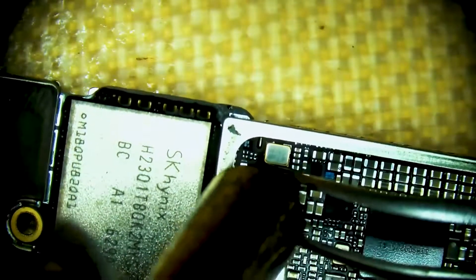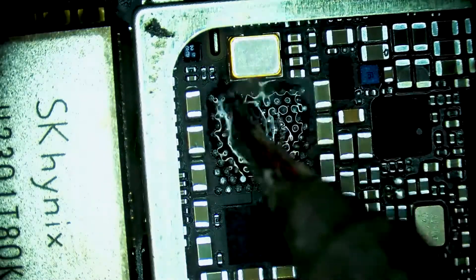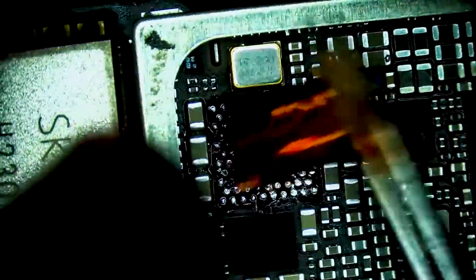We're going to use the gravity method to let the board fall once the solder reaches melting temperature. That way we can use minimal heat, because the baseband CPU is on the reverse side of the board and we don't want to flow the solder underneath that chip — it is underfilled and that could cause bridging and other issues that we don't want to deal with.